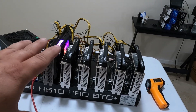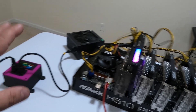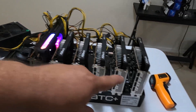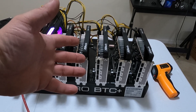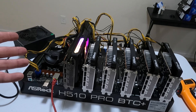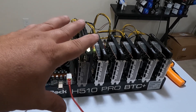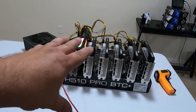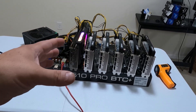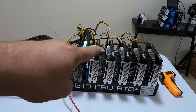That's basically it for part one of this video series. We wanted to bench test everything, make sure it runs, and get some numbers — 445 watts, all the cards running at about 40°C, and 14.2 kilohash out of the whole rig, more efficient than AMD 6000 series. Make sure you're subscribed because we're doing a part two — I'm not doing open air cases anymore. OctoMiner spoiled me, but unfortunately you can't use these in OctoMiners since they don't support resizable bar. So me and Rondy are going to cobble together some sort of enclosed case with fans. Stay tuned — Rondy's going to pull something out of his hat.